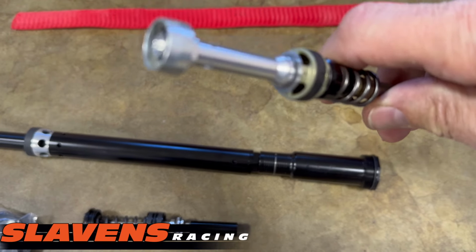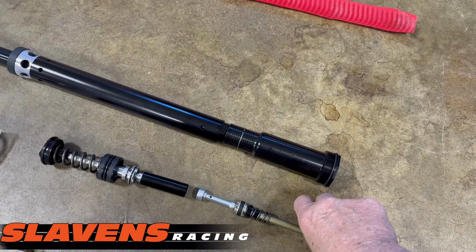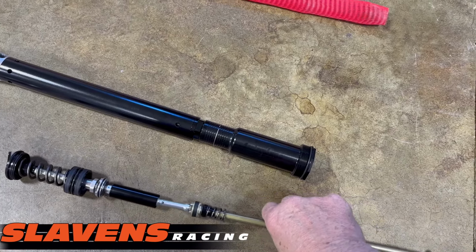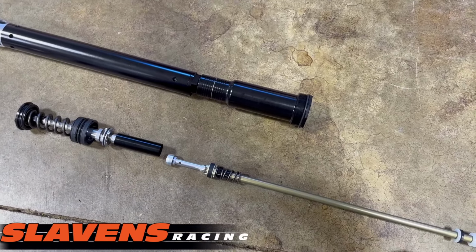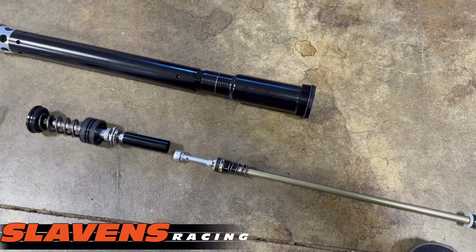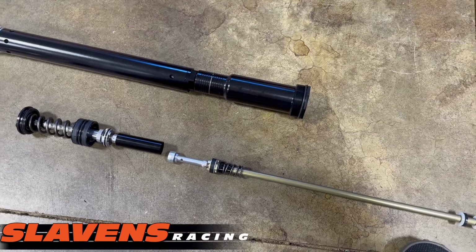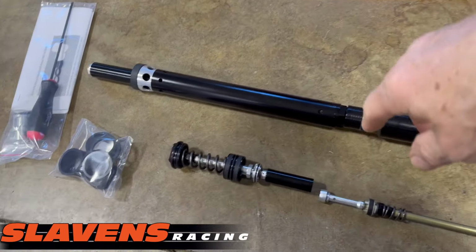The hook valve is something that Jeremy invented many years ago, and he's perfected it over the years. It's tunable down in here. And this fits inside this cup that is filled with fluid and creates a hydraulic lock. And that's what gives you that really great anti-bottoming. You'll never ever get a metal-to-metal feel with these, never. You can ram it into a wall and it still will not give you that metal-to-metal bottoming that hurts your wrist. I think that's about it on the spindle.